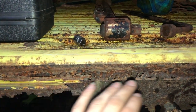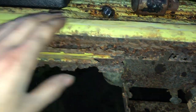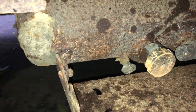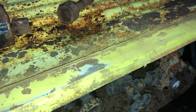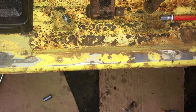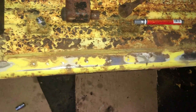Before you even start this repair, get all your repair panels. You're going to need an inner sill, a middle sill with sliding door track - outer sill is optional, you don't need it immediately. Any other thing you can do while you're here, like corner outriggers, get that done too. Get the propane tank off - I'm letting mine soak because those 13mm bolts don't want to come out. To find the spot welds, I've already found one - I'm just going to sand right here with 80 grit using a Dura-block to keep it flat. I've found most of them and determined they're approximately two inches apart. Now we're going to drill some locating holes - probably three of them - then get some bolts through, and we can start.